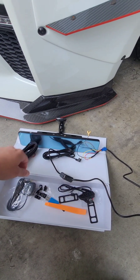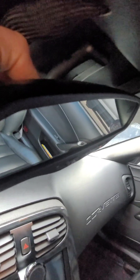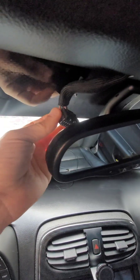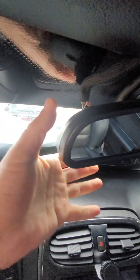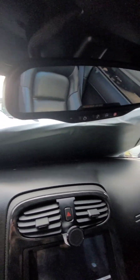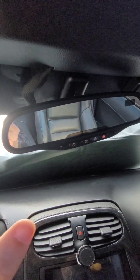It has a clip behind it — all you have to do is squeeze in the middle and the clip should come right out. It's kind of hard doing this with one hand. Just pull the tab on top — it's easier with two hands. Hold the mirror with one hand, push down the tab with the other, then push back and wiggle it and it'll come right off.